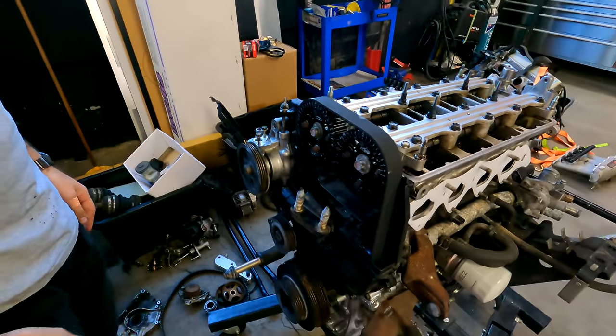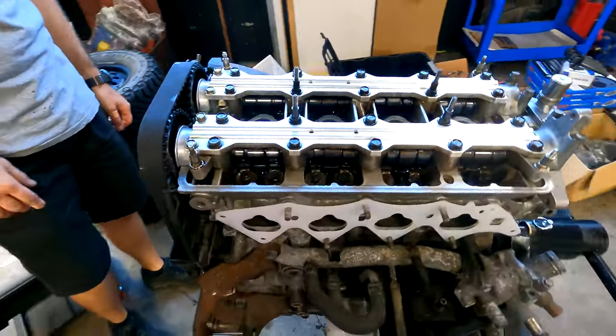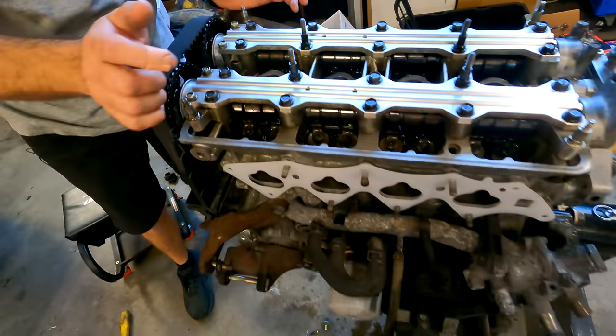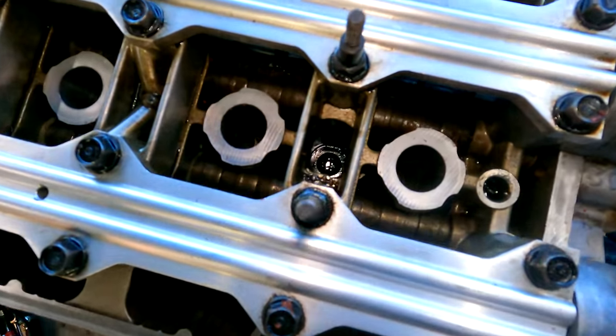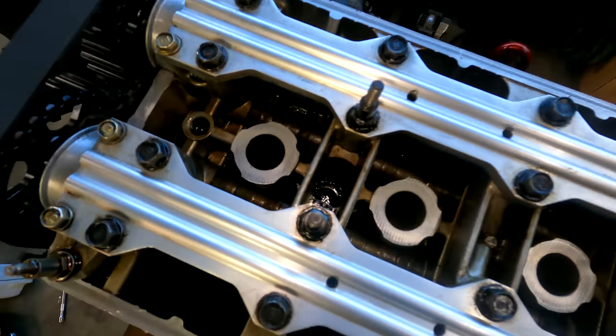This Civic is way more work than anyone expected. But everyone knew it would be there — you've got it out on an engine stand, you know? It's never gonna be easier than it is right now. So we've got some stuff to do today, but I'm feeling good about it, man. This guy's been re-threaded now, so he should actually work. We need to clean out and put new spark plugs in because that still has, like, dead grass in it. We're gonna try and get our clutch and flywheel and gearbox on today as well if we can. See how we go.